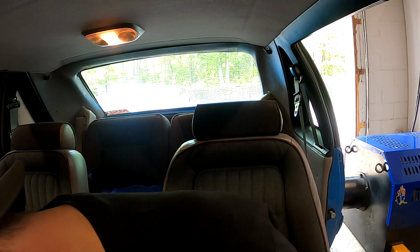So I'm just gonna make a run like this, log the fuel pressure through the dyno, and if it's dropping pressure, then we might be kind of done until he sorts it out. For whatever reason, this thing has like, see, there's that shit I was talking about. It just shuts itself off sometimes. This has like 29 different fuel filters on it, and they're all the real little ones. So this very well could be a filter problem, or I could just be wrong altogether, but I guess we'll know here in a second.